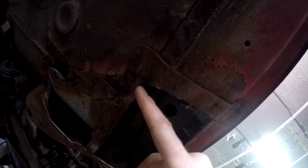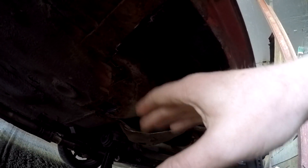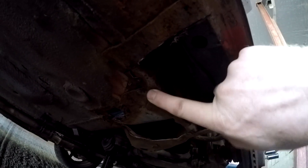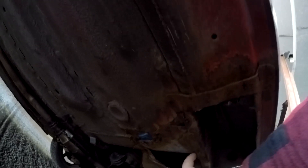The only problem is this is a connection point with multiple layers - there's the floorboard and then the front plates come here, so it's all double and triple connected. Then here is a jacking point. The structural side has metal coming down and folding over, with a bigger piece of metal that spreads any load over the whole thing. It's very simple. This should be very doable - it's only this side, and then the same spot on the other side that needs the same kind of attention.